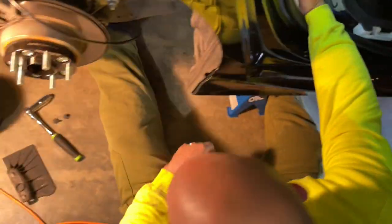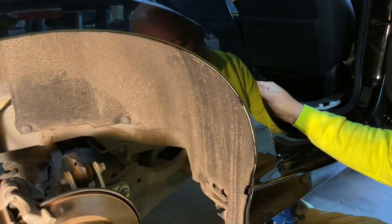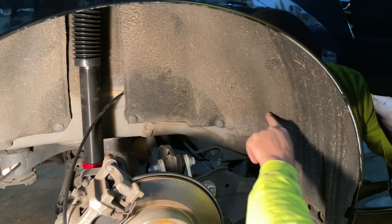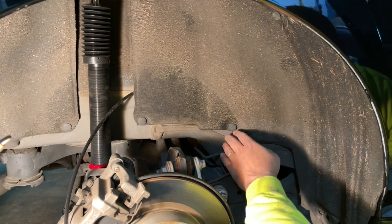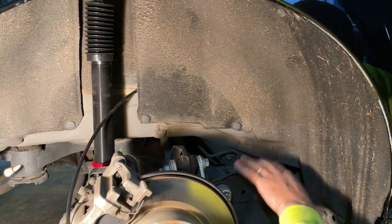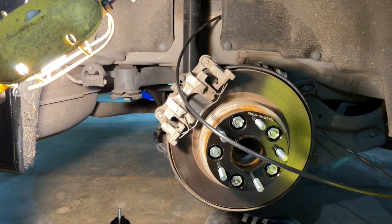And then on the other side here, you remove this little mud flap. It's two 10 millimeter bolts. You pull this out, and then you can fish that line through. And what you can see I've done too is I've gone along this whole firewall, the flocking for the inside of the wheel well, so we made sure that it's up and out of the way of the suspension being able to pinch it. Basically, we're going to cut it to length, plug it in here and mount the bag. And then we'll see you in the next video clip.